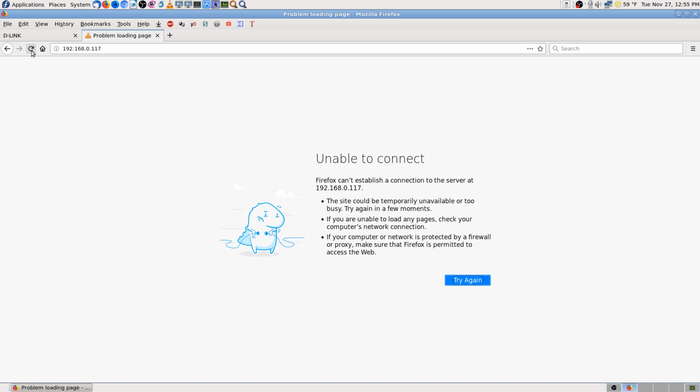See, with it being a switch, any port can be your uplink port. Well, then there's three DHCP servers fighting to send IP addresses out to this switch because I've got three routers plugged into it. So I can't do all that daisy chaining to all the other routers. That's why I have extra ports, because at first I had not planned to plug any routers into it. Then I had it planned out to where I was going to have one port left, or maybe two.